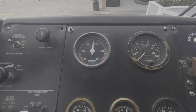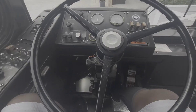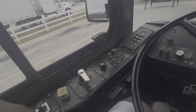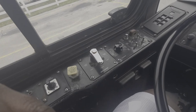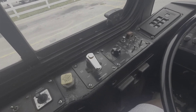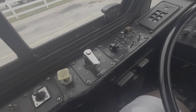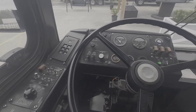You can now move on to the brake response test. Continually pump the brakes again until the air pressure drops to at or around 40 psi. When the air pressure gets to at or around 40 psi, the parking brake will engage itself. Once the parking brake engages itself, take your foot off the service brake and let the tester know that the brake response system is working properly.